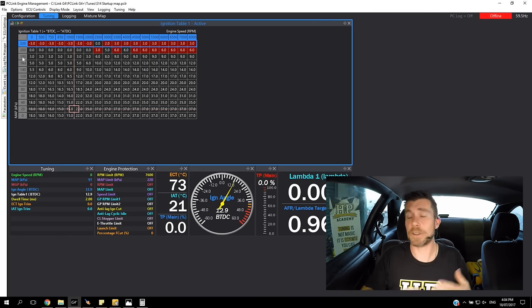We've just extrapolated those numbers and taken a broad guess. As we move into the next untuned area — in this case maybe 200 kPa — we can fine tune that guess and then further extrapolate those new values out to 220 kPa. All the time we're taking the information we've learned and fine tuning our guesses out into those untuned areas. The idea behind this is twofold: first, when we do move into an untuned area we should already be very close, reducing the chance of doing damage to the engine. Also from a commercial aspect, if we're tuning cars for a living, it's going to reduce our time spent on the dyno.